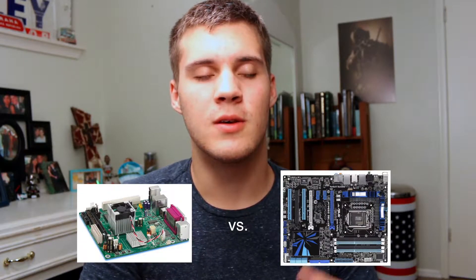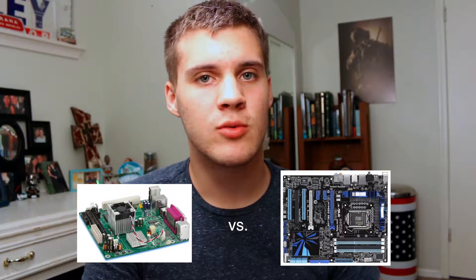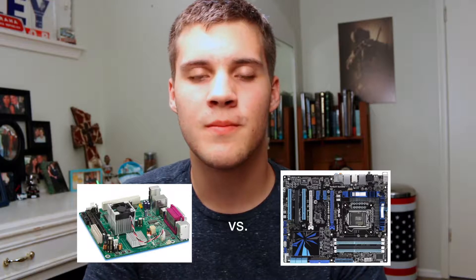The fourth thing we're going to be looking into is the features and ports of the motherboard that you want to get. Starting with ports — things like what you plug your graphics cards into and your RAM into — you want to make sure you have enough for the kind of build that you want. This is going back to step number one, which is determining your uses. If you're a heavy user, you're probably going to want a lot of RAM, which means you're going to need more RAM slots. You don't want to get a small motherboard that doesn't have any ports for the components you want to put into it. Also, if you want to run two graphics cards at the same time, you're going to need two ports for your graphics card. You also want to make sure that if you want to use those graphics cards synonymously, you have SLI or crossfire capabilities on that motherboard, and that's something you're going to have to research because it's different for every motherboard.